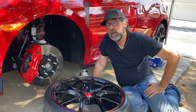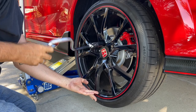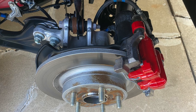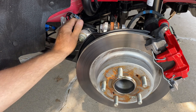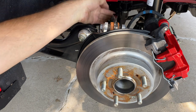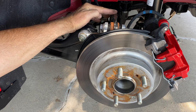That about sums it up for the front — I'm going to put this tire on and move to the back. Well, here we are at the back, and I've got to say this isn't nearly as radical as what we saw in the front. Obviously this vehicle has a much wider track width, so there are some different parts here, but it's mainly restricted to the knuckle and a few bushings. The rear suspension here is a multi-link type — this is known as a control blade multi-link suspension.